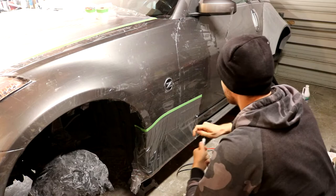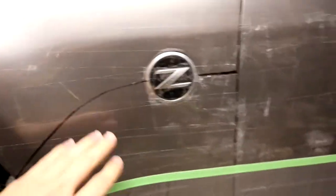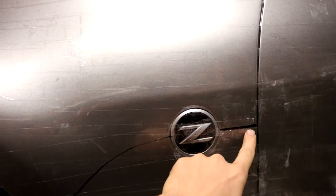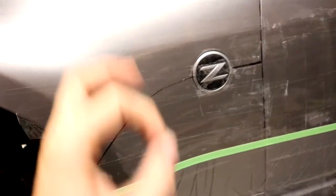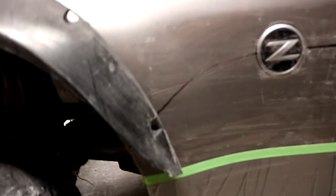All right, so after cross-referencing with my tailoring tape, I just made a slight adjustment, like less than an eighth of an inch right there. Just raised that line up a little bit, and it's just gonna get me a little bit of a closer accuracy. It was already very, very close. In fact, these lines right here are perfect. No adjustment was necessary, and just this little line needed to come up by about an eighth of an inch or less. So now we are in perfect position, or definitely close enough at the very least, to go ahead and lay up our polyurethane universal flare back up on there, and that will tell me exactly how much of that I should cut off.